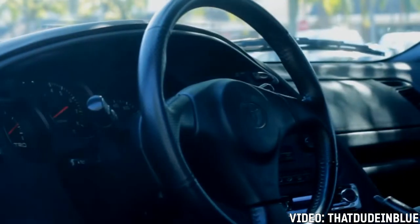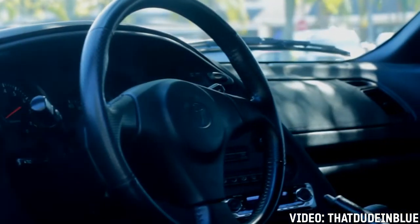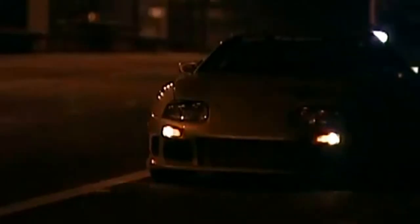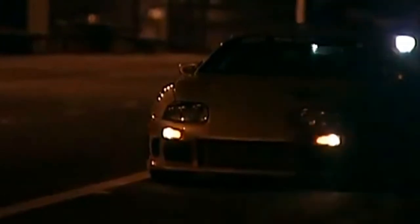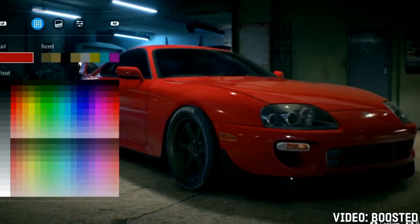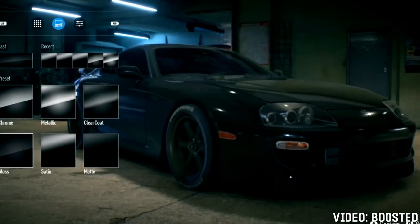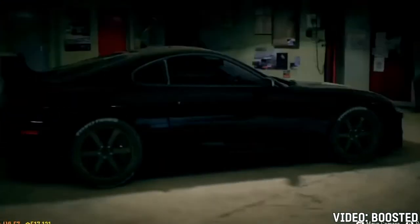Make sure the car accelerates smoothly as you go through the revs. Use all the gears in the transmission and make sure they all shift smoothly. Listen for clicking or popping noises coming from outside the car while driving. Make sure the brakes work smoothly and are reasonably quiet. Make sure the car tracks straight on flat roads. Listen for rattling in the targa top if applicable. Make sure the power steering is smooth and quiet.